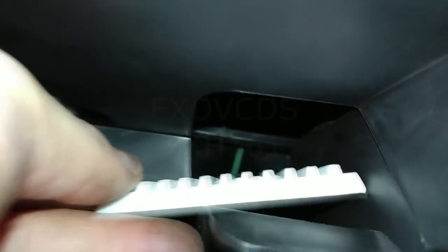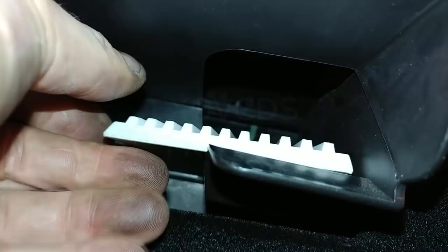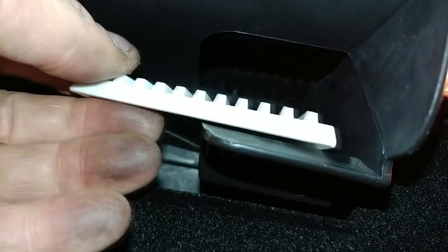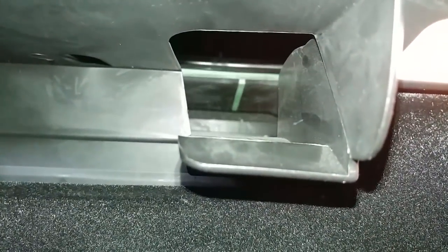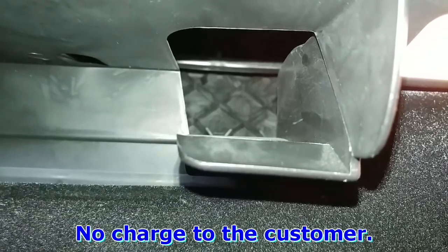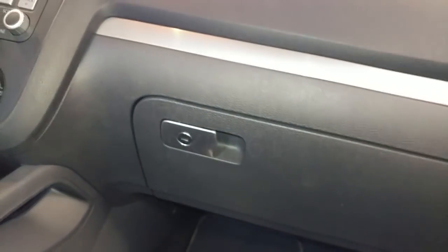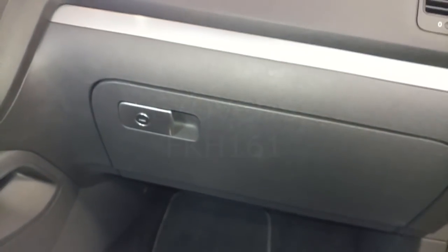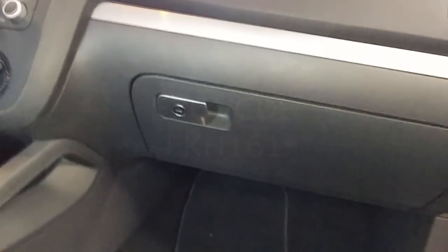You can sort of see it reaches all the way to the flap. So basically what was happening is the flap was binding, computer wanted it to close further and it couldn't, and it was ratcheting. Now that the obstruction is gone, no more ratcheting. So if yours is making noise, check that first. Otherwise, in order to remove this, you have to remove the glove box. I'll link a video in the description to another video that I made about changing that motor.